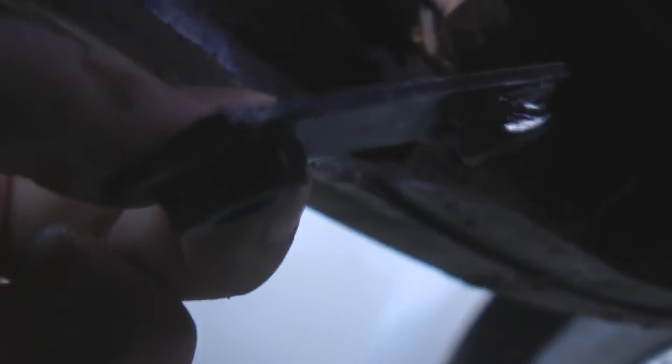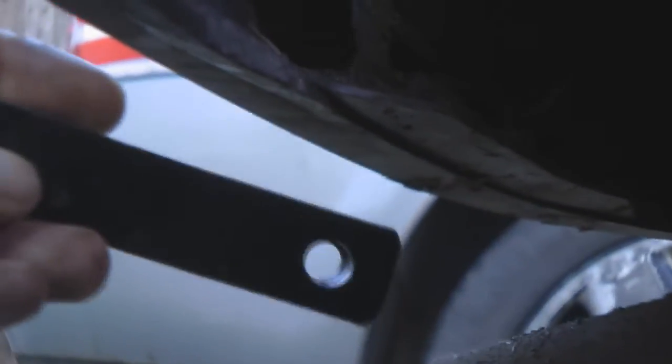There are four of those bolts so I decided not to bother. Because the tow bar fastens onto this piece here, the only way to access the bolt holes from the rear would be to take the bumper off. However, I fabricated this captive nut strap which hopefully I'll just be able to slide up in there and then tighten up onto that. So hopefully that will work out — that saved me having to take the bumper off. I know some tow bars do seem to have one of these included, whereas the tow bar I ordered was just two separate nuts.